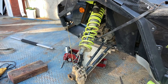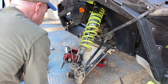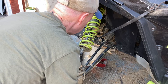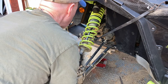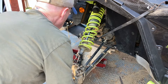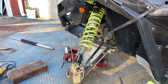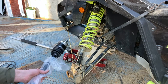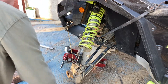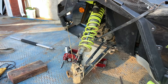I got my bottom two bolts in, got it lined up — I think that's right. I'll clean up my welds later after I get it in the shop. My welding, especially when you can't reach it or see very good, is not great, so I'll have to grind some up and re-weld them or at least clean them up. They look terrible but they're solid. So I've got the lower control arm back where it needs to be, and now I've got the axle shaft here — hopefully we can get that put in and get my brake rotor back on there. I'm about to run out of daylight.